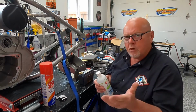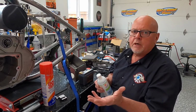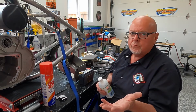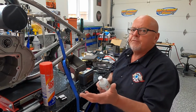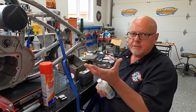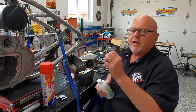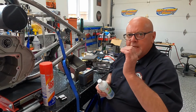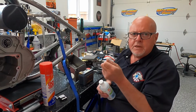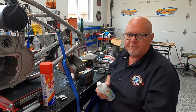Where Harley Davidson used that, by the way, is in the tour pack. There's a real cool organizer that goes in the tour pack, and it goes against the lid. And all kinds of guys were resorting to contact cement because they followed Harley's instructions and used the pads that came with the organizer. And the pads, when I looked at them, were rubbing alcohol. So you rub that on the surface, it dries, and it leaves that nice white powder residue, a nice layer of it. You stick the adhesive to it, man, it's going to fall off in no time.